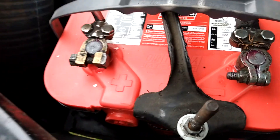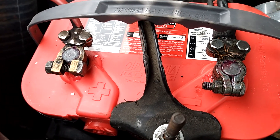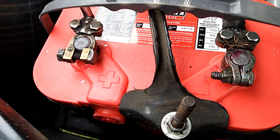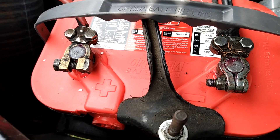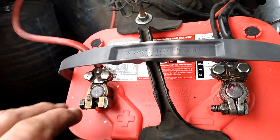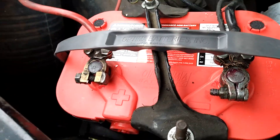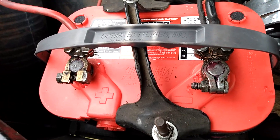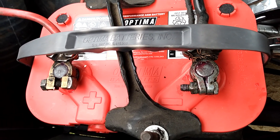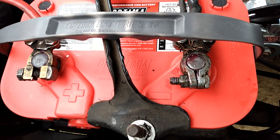The terminals from the battery were new, obviously, but I still gave them a quick sand. And the clamps — I also took a little wire brush, a circular wire brush, to the inside of each of them, tightened them down, made sure they were tight, and also made sure I had a good clamp — not a bungee cord or anything like that — a good clamp to hold the battery down. This is a $220 battery; I don't want it flying around and getting damaged.